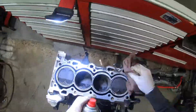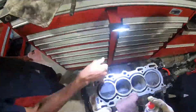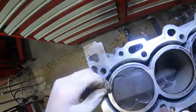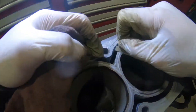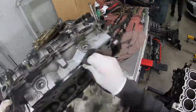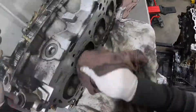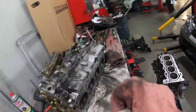I want to make sure I'm doing it right, or else I'll think I could have done that better. But now I know the basics and the next time will be better — you can always keep improving. You can see on the block I'm removing the old gasket, but I'm not scraping against it, I'm going with it — pulling rather than pushing — so it doesn't scratch up the head. I used some brake cleaner to clean up the surfaces.